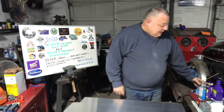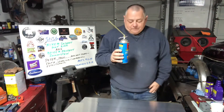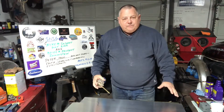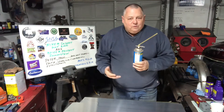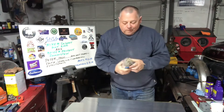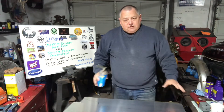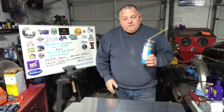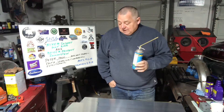I'm going to put some reinforcement beads along the part to give it some rigidity underneath the outer. Then I'm going to put the two together and hem the outer — the part you'll see — around this inner piece and it will have more rigidity. To make sure it has good rigidity, I'm going to use window and door expandable foam. I'll get everything together and fill it with this expandable foam — the kind you use around windows when you replace them or want to keep wind out. It's really good, simple, easy stuff to use. I'll put this between the two panels, both will be beaded, both will have rigidity, and with the foam filler between the inner and outer, I think we'll have something that will be plenty strong and stand the test of time.